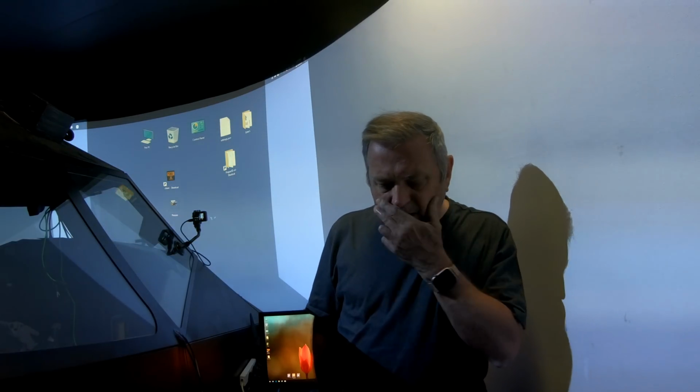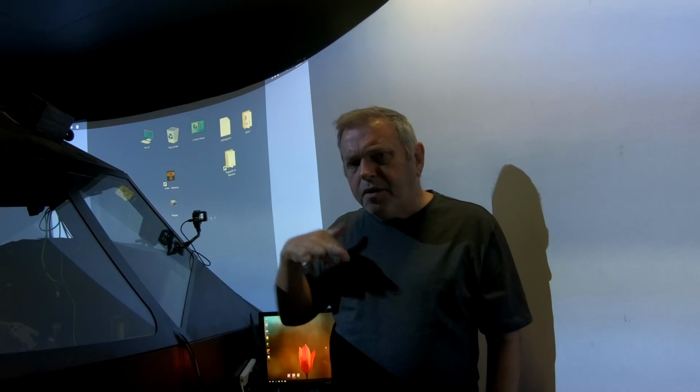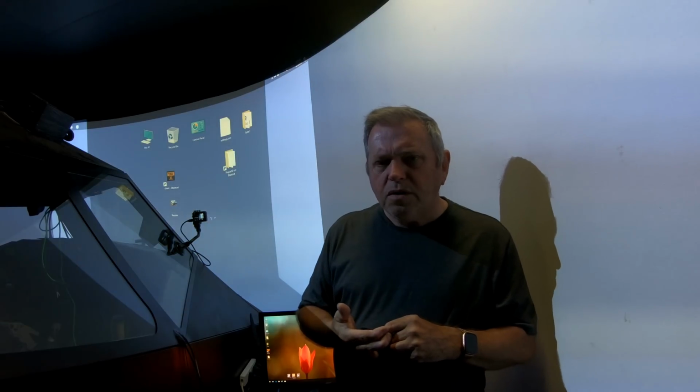But before we start all that, there's something that I have known for quite a while and didn't act upon. If you go back through my videos here, you'll notice that about 6 months, maybe 12 months ago, I started having a lot of problems with calibration, the actual colors between the three projectors. And I thought it may have been because my bulbs were getting low, but it wasn't feasible because I've nearly always run the three projectors together, so the chances of that happening were fairly slim. And even if I did, I might have had the center one on for maybe an hour more than the others, so it didn't really ring true, and I just couldn't understand how it could have got so far out. In actual fact, my center one was the problem.